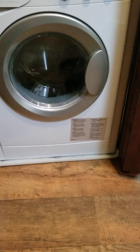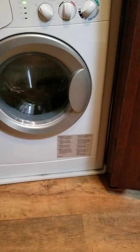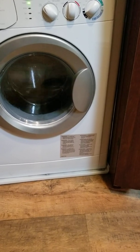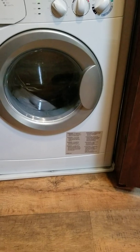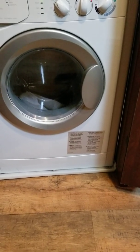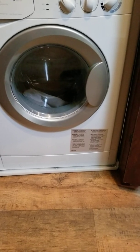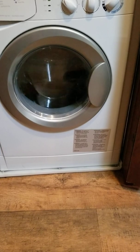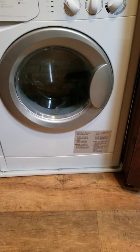Now you're probably going to have leftover water in there. Be prepared, and that's why we have the towels. The pump at that point just comes right out. Putting the new one in is in reverse order. There is a tab on the front of the pump, so when you slip it into the frame, it kind of holds it in position until you get the 2 screws to secure it. I mean, that's all there is to it.